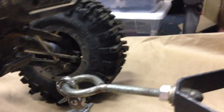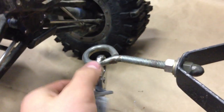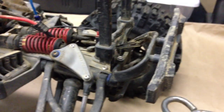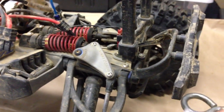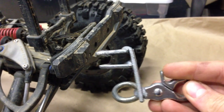So here's the hitch that hooks onto the Summit. As you can see there's two different plates on there with holes drilled completely through and there's also a little clip. Pretty much what you do is you hook this on where the rear bumper goes. As you can see there's screws going through this plastic right here — take this bumper off, slide this right in and put these two screws right through these holes and now it's perfect. So all you gotta do is make one of these and you're all good.